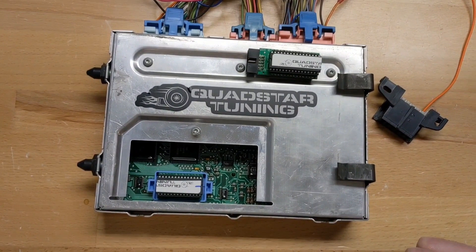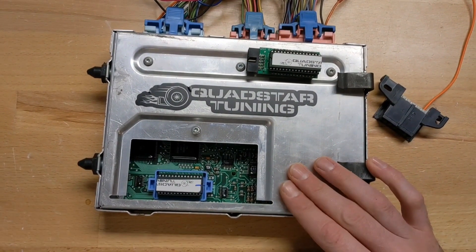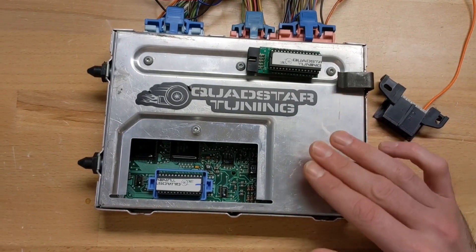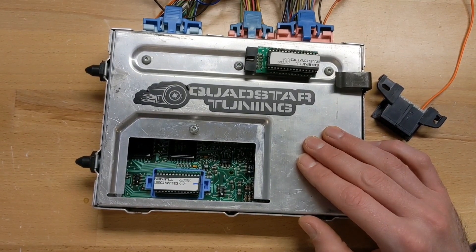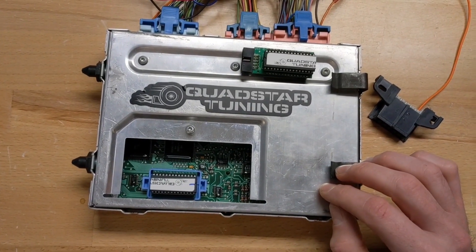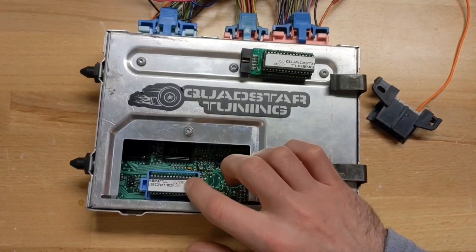Get your stock chip off to the side and you're ready to do an initial startup. The first time you turn the key on, your glow plug cycle is going to run short and cancel out because the timer hasn't had a chance to reset in the computer. So what you want to do is turn the key on once, let that short glow plug cycle happen, turn the key off, and wait — about 30 seconds usually, sometimes only 10 seconds. Then turn the key back on and you should get a full glow plug cycle.